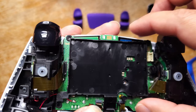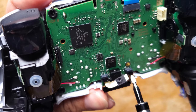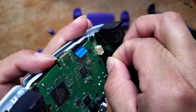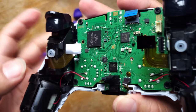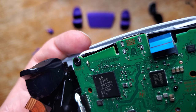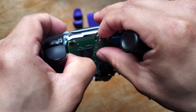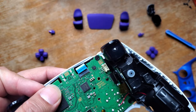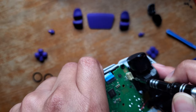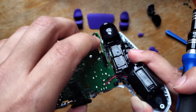After that, you need to disconnect four ribbon cables — one here, another one here, another one here, and the last one is right here. Now to take the green board out, you have two little locks — one's right here and the other one is hiding right here. Just push it aside and it'll come loose. Once you've got one side, do the other one. Carefully move your ribbon cable and watch out for the rumble cables too.